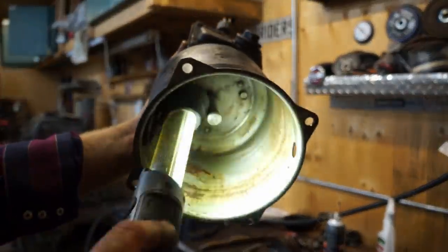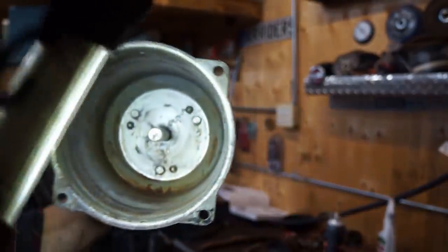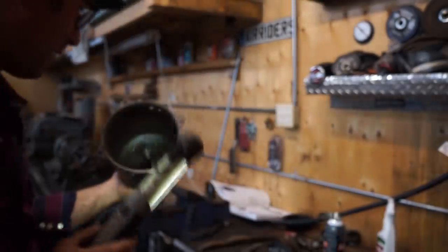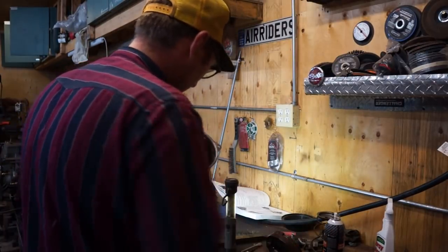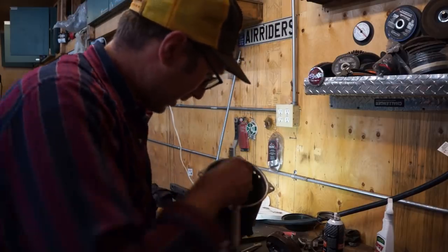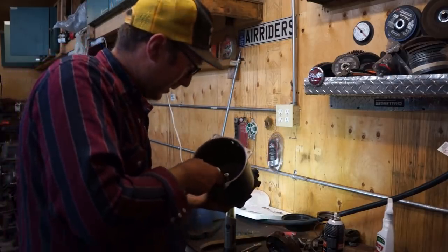There we go. Pretty gross. But I'm sure it'll become serviceable again. It's not like there's holes in it or anything. Just a lot of gunk. But I can get at my three bolts now. It was probably those fine guys at Ford. They did it like this so that if it did leak, you had to remove the master cylinder. You're forced to take a look and actually see it, instead of just bolting on a new master cylinder, things full of goop.